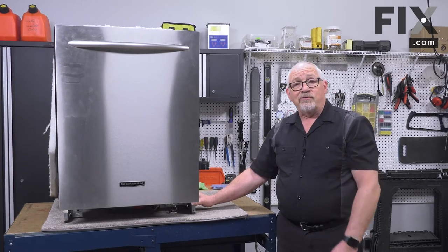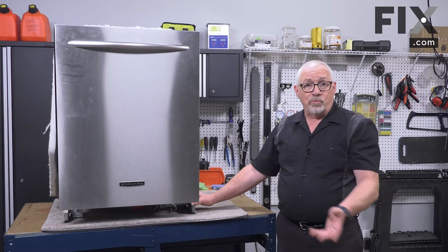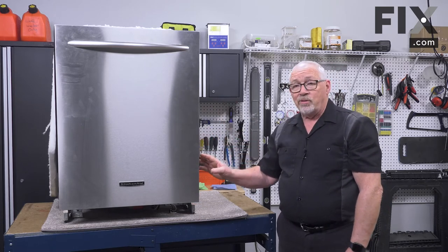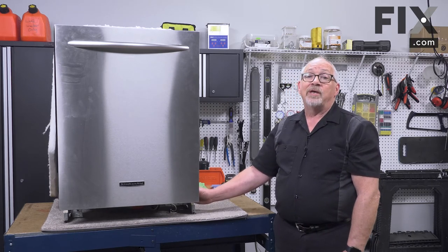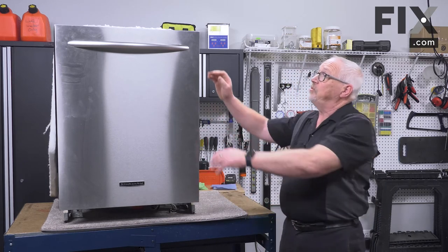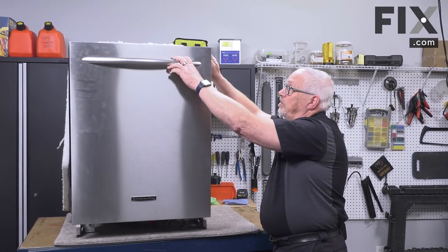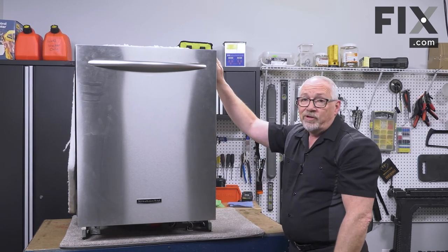If you're looking at a secondhand machine, or you've had the dishwasher pulled out and put back in and now have a leak around the door, you'll want to look at the subframe to make sure it's not bent. The quick way to tell is to open and close the door and make sure it comes in and sits against the gasket without banging on either side of the tub.